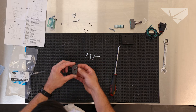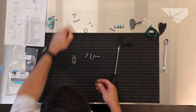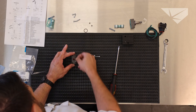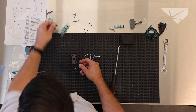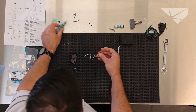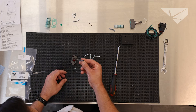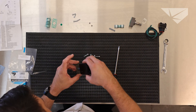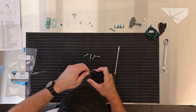Because this is a new solenoid, we're going to have to leave the felt inside of the unit, but we will put the two smaller O-rings in. We would have put the replacement felt in, but we don't have to this time. The bigger O-ring as well. Then the replacement spring. We're going to go ahead and put the assembly back together using the shorter screws.